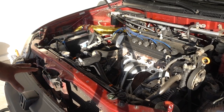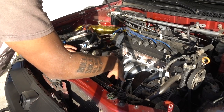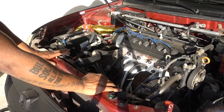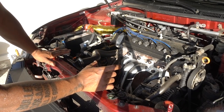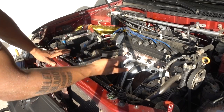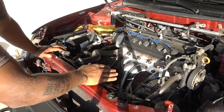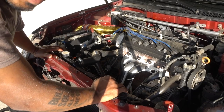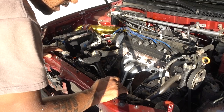Installation is done on the radiator. Make sure you check all your connections and fittings, make sure everything is tight, bleed your system, and if you need a new cap get a new cap. Most importantly, you have to add some transmission fluid because some of it will stay in the old radiator — top it off and check your level. That's how you replace a radiator on a 1998 to 2002 Honda Accord with an automatic transmission. If you have any questions, please comment below. Thanks for watching — don't forget to subscribe!